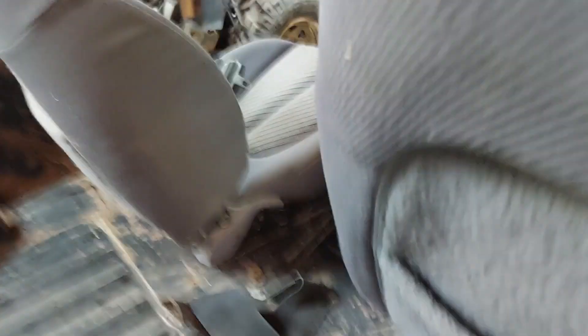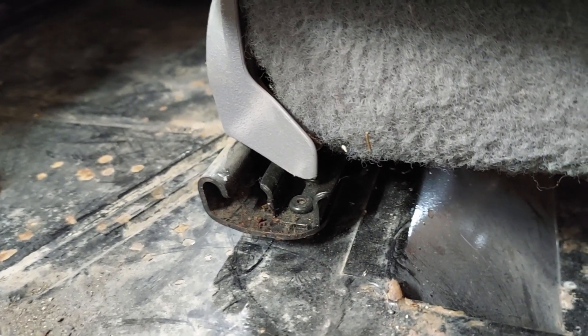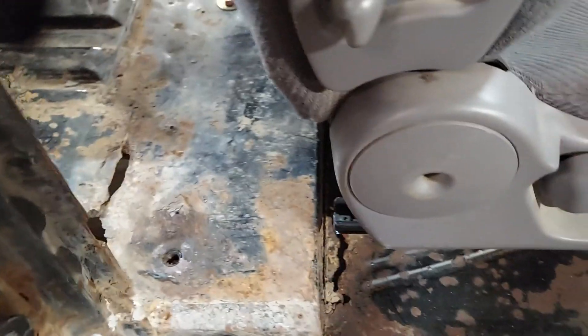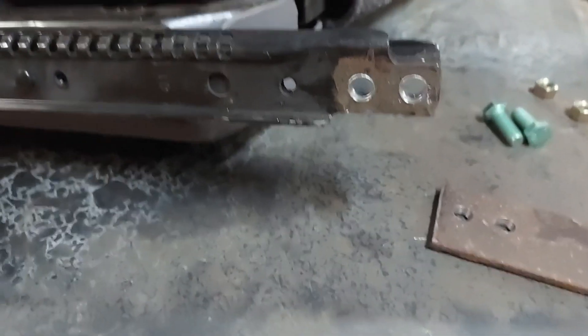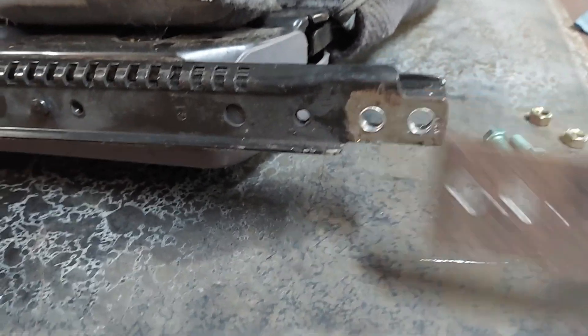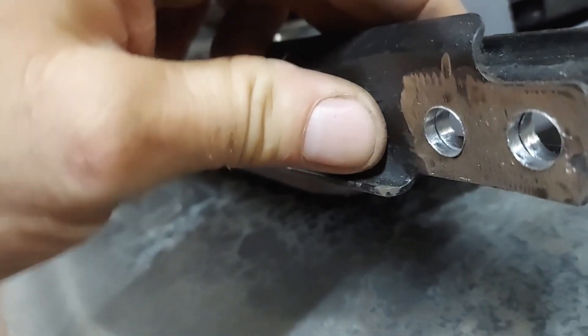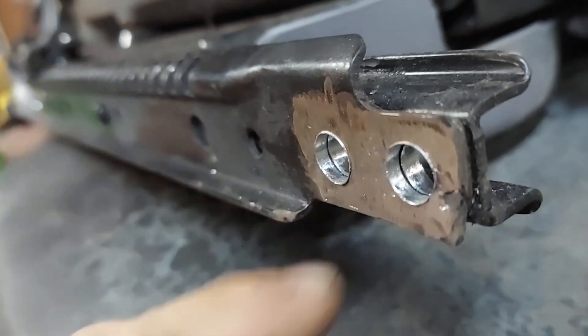Front's bolted down and with the seat slid forward I can see what I'm dealing with back here. Over here on the inside I should be able to just knock the rivet out just like in the front and drill it out to three-eighths. On this corner it's going to be a little different because there's nothing there. As rusty as that floor is right there, I don't want to do a spacer, so I'm just going to weld an extension onto here and get it into this area which is a lot more firm. Little change of plans — instead of welding the plate to this corner I'm going to bolt it on, because bolting it will get both pieces of the channel rather than just the very bottom piece.